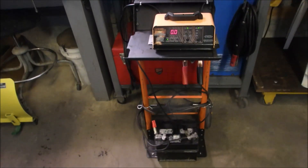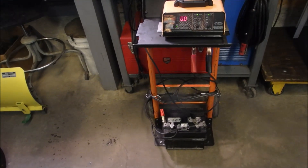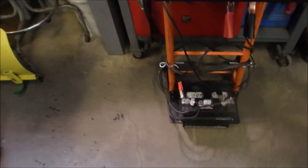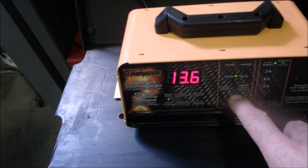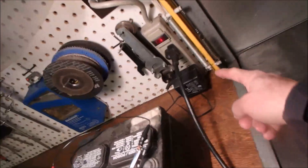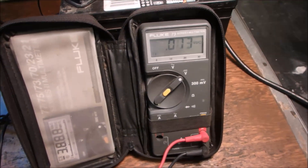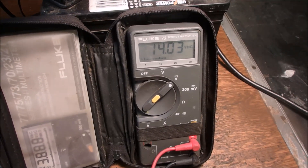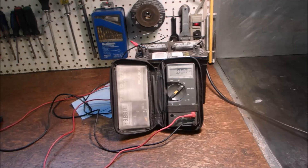I'm done the little portable charging station. I have not given up on this battery yet — I know it did a terrible job of starting the tractor, but I've had a lot of experience with batteries. If you stay at them, sometimes they'll come back, and it doesn't cost me anything to check. So it's on charge. The little charger that's been doing the job: current is at zero amps, 13.6 to 13.7 volts, and it says the battery's full. And then I've got the little trickle charger on the LX178 tractor battery — it's been on for 24 hours, and we're at 14.03 volts, which is absolutely perfect. So that's the end of this little battery series. Thanks for watching.